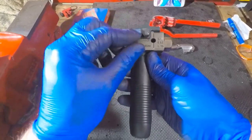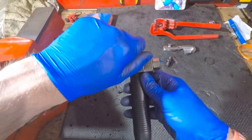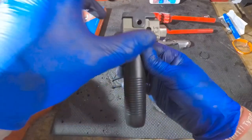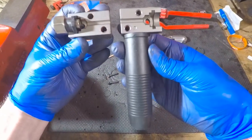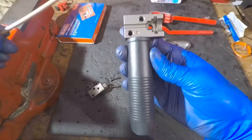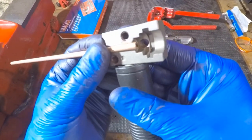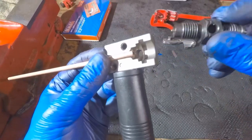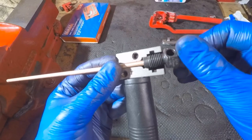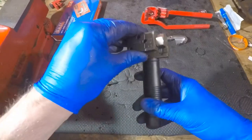Just for the purpose of this video, I'm going to take these all the way out so you can see exactly what's inside, because I've seen lots of videos on these on eBay but I've not seen anyone actually undo one to show you exactly how it works. It's pretty much a standard kind of die — you can see where your copper pipe goes in and it gets clamped inside. Then your die that you insert gets screwed in and it basically forces the flare into the end of the pipe. It really is a simple but fantastic bit of kit.